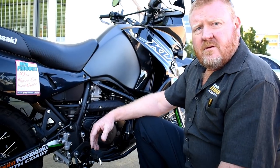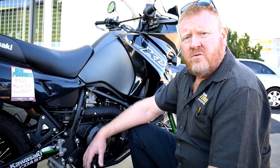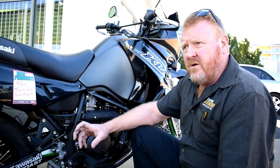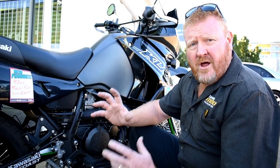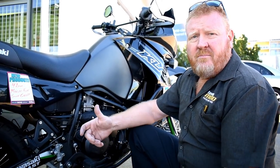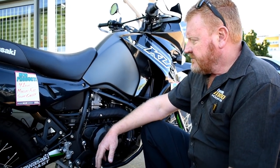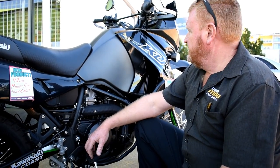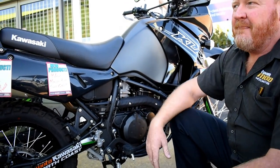You still retain your warranty — we tune it up so it's not going to blow up on you. Some of the fine tuning takes a little bit of time because the carby is so hard to get in and out. You tune it, go for a run — she might pop a little bit, might be a bit lean off the bottom, a bit rich at the top — so then we change a few things. If people do aftermarket stuff or modifications on the carby or engine, Kawasaki is solid — no problems there.